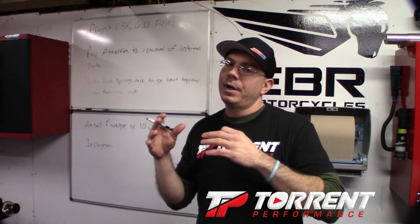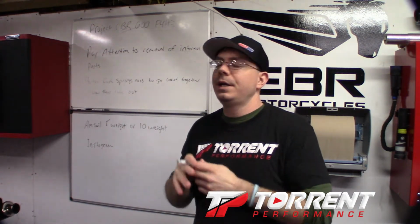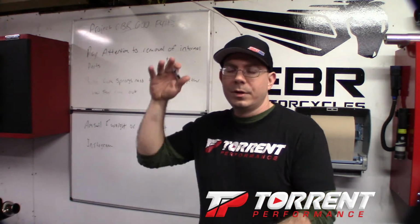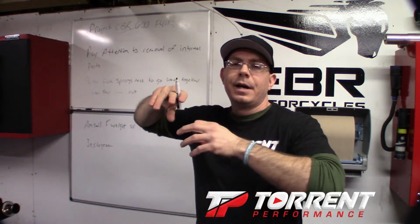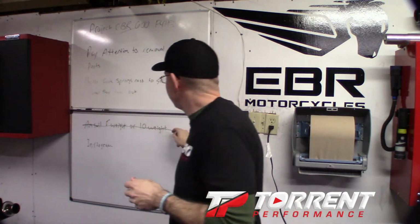As you'll notice in this video, I will actually use Amsoil 5-weight oil. The OEM standard weight oil is 8-weight. Amsoil offers 5 or 10 weight. 10 weight would have been okay, but I talked to Nick and we talked through his riding style, and the roads here in Illinois are really bad, so I want the forks to react to potholes and crummy roads. So we decided to go with 5-weight to allow the fluid to go through the dampening rod and the internals of the forks faster. We want the forks to react faster, and then we can manipulate how the bike reacts on the road with the adjustable settings. So we're going to use 5-weight oil.